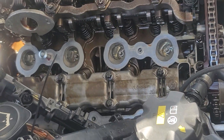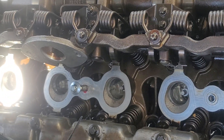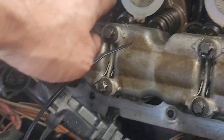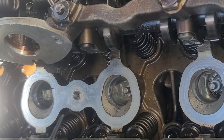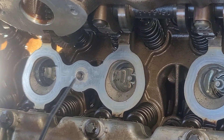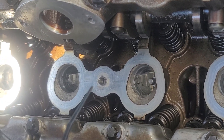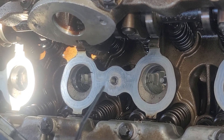I'll run it down until the TimeSert stops, then pull the bolt out, leaving behind the TimeSert — without having to purchase the TimeSert install kit, which saves time and money. Now I've got it in place. I left just a little bit of it sticking up intentionally — I didn't chamfer it — so that whoever the next person is that works on this will realize some of these bolts have been stripped. The gasket and valve cover will still be there, so it's still going to make a seal and still be able to torque.